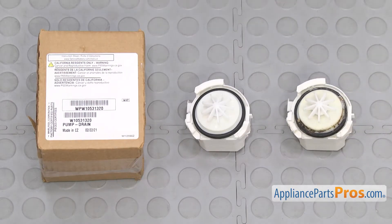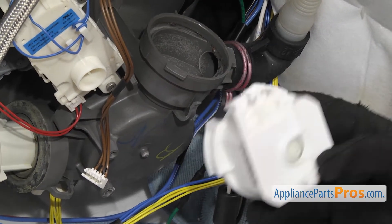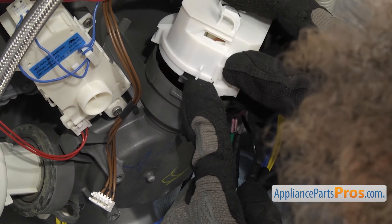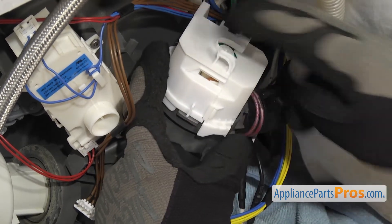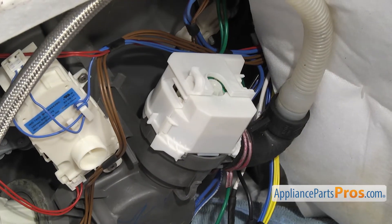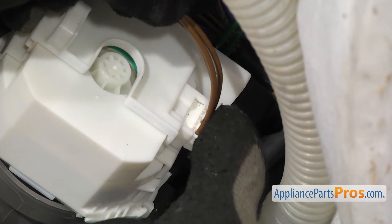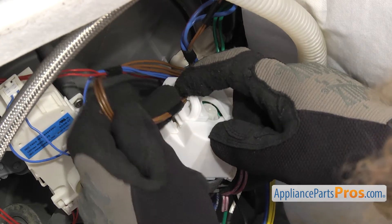Here's the old drain pump next to the new one. If you already have one of these, great. If not, you can get it at AppliancePartsPros.com. To put the drain pump on, all you have to do is snap it onto the sump. There's a tab right here that you want to make sure the tab on the pump is lined up with. When you push it down and lock it into place, the wiring harness plug will be over at three o'clock so you can put the wire in. To put the wire in, just snap it into the drain pump. Once you have it in, we can lift up the retainer and slide the wire underneath it.